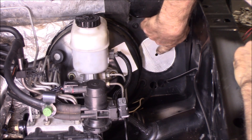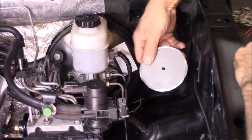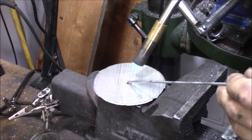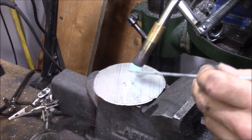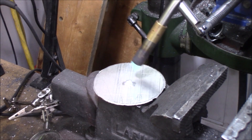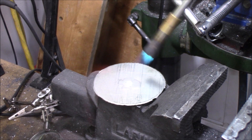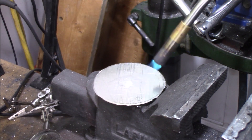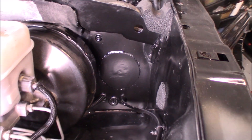I'm going to fill that hole, paint this black, and glue it into place with some black urethane. Here I'm using MAP gas with aluminum welding rods you can use for propane or MAP gas. I do have to get it rather warm, and I'm actually pretty impressed with these — I'll put a link below to an Amazon link where you can get them. You can see how once you get it hot enough they'll just kind of melt into place. There I got the plate all installed and painted — that looks a lot better than that large grommet.